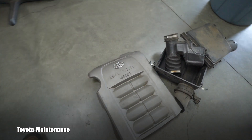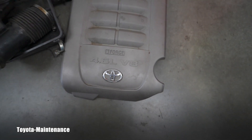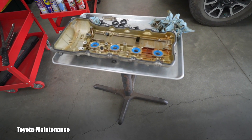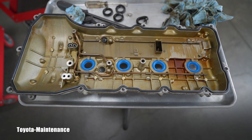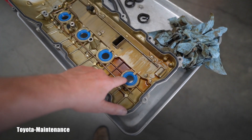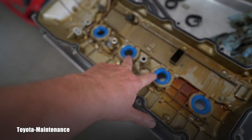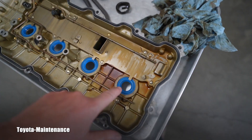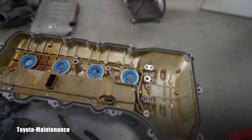So now it's evening and I'm still dealing with the valve covers on this 4.6 V8 engine. When you lift the hood you can see it's a 4.6 liter V8. Finally we have some great news for the owner — you can see the valve cover, how beautifully clean and shiny, no crud or nothing like that. We are doing this job because of the spark plug tube seals. The middle ones on each side were leaking into the spark plug tubes; the outer ones were actually holding correctly.